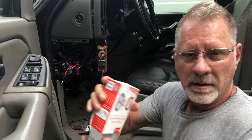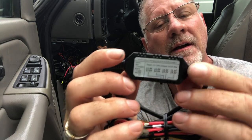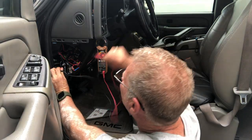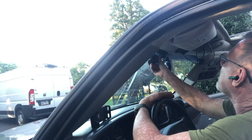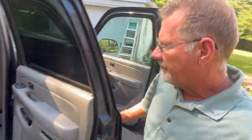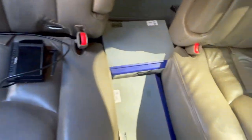But what if you want to record a little bit longer than that? You can get a hardwire installation kit, which is what I had. I hardwired mine in, and it's got a little gadget with a dip switch where you can set how much power you want your battery to have before it just shuts off — it's not going to run your battery down. I set mine to 11.8 volts. The vehicle will still start with that. But I went ahead and took it a step further — you know me, I can't leave stuff alone — I installed some coach batteries. So I've got 200 amp hours that get charged when the engine's running, and it's never going to run out of power.